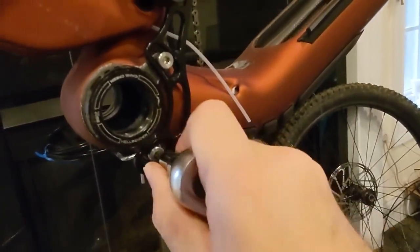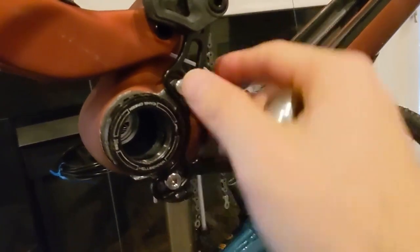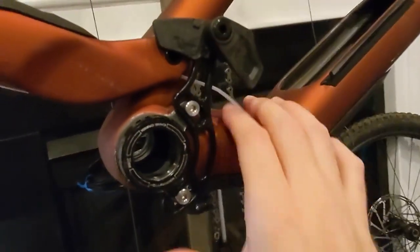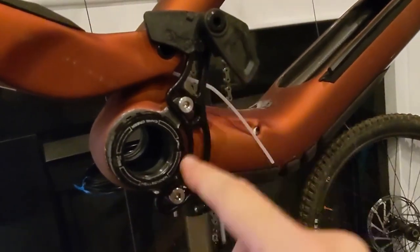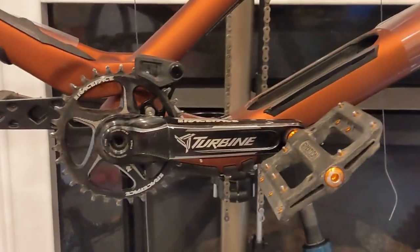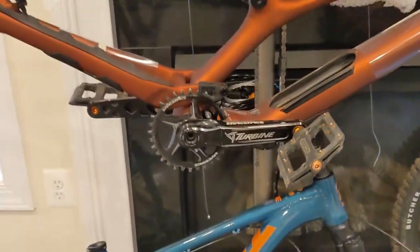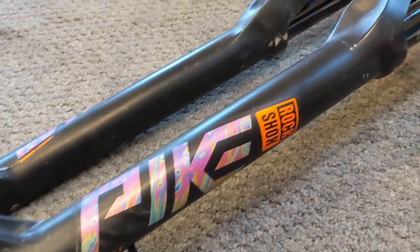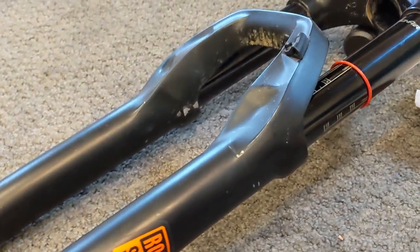This is my first time with a bike that has one of these chain guides. Specialized instructions just say to kind of snug it down a little bit and then put the crank through, then adjust the position to where it needs to be. Cranks in place. Next I want to try to get the fork on there — see if I can get the crown race put on this Pike, and the new headset bearing in place. Then we'll look at the back of the bike.